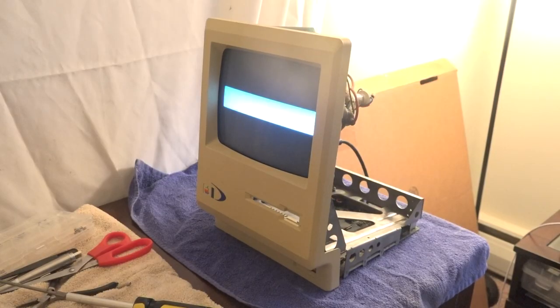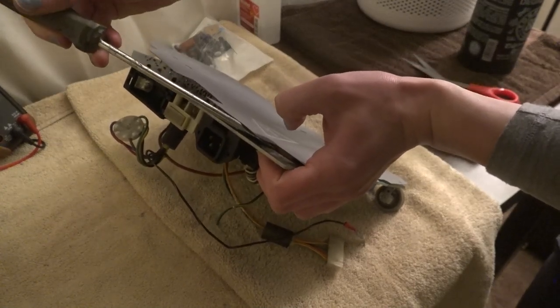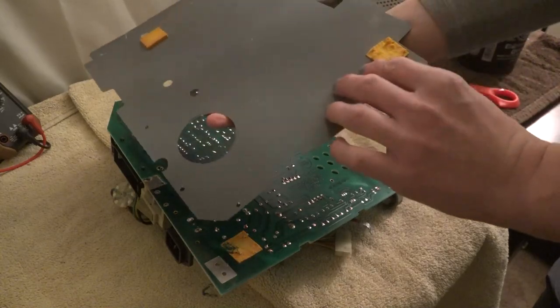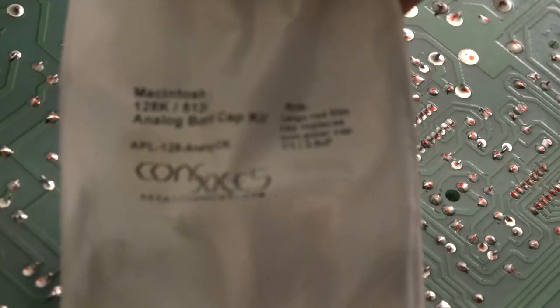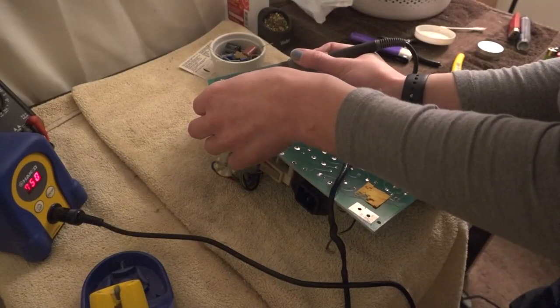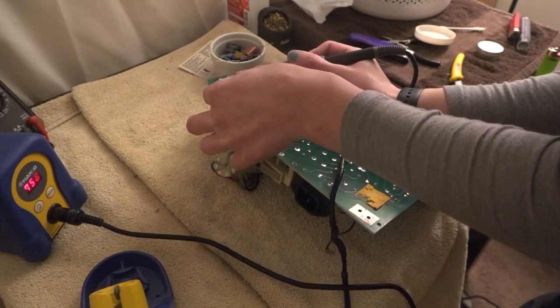Now you may think the picture issue can be fixed with some slight adjustments, but I suspect that the vertical collapse is caused by an electrical issue — either cracked solder joints or bad capacitors, or both. So my next step is going to be to inspect the solder joints on the analog board and recap the entire analog board, because if the capacitors aren't bad now, they will be going bad eventually. So my first step is to carefully remove that high voltage shield without ripping it. Right off the bat I already noticed a few cracked solder joints, so I'm definitely going to have to be doing some reflowing. As for the replacement capacitors, as always I'm using a recap kit I bought from console5.com — I'm not sponsored by them, I just really like their recap kits. The recapping process is pretty straightforward and repetitive, so I'm going to be fast-forwarding through most of it.